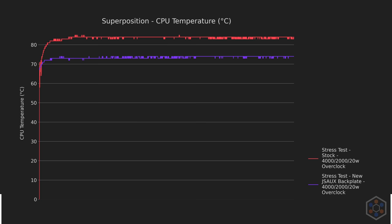The GPU also ran 1–3°C cooler with the PTM pad than the Noctua paste. On Returnal, the overclocking temperatures are nearly 10°C cooler, and stock clocks come in at around 2–3°C cooler. The GPU temperature dropped about 8°C when overclocked. Despite the much cooler chip, these results are the best I've ever seen on Returnal — every metric is higher, especially the lows, with stock and overclocked results notably higher than with the Noctua paste.